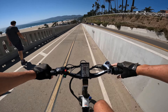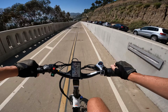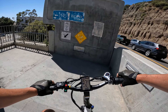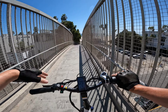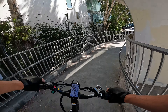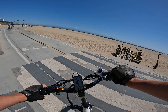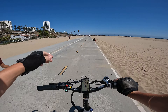Going downhill would be our best chance to see top speed on this bike — you have to let off the throttle and do a little ghost pedaling for the motor to help you. In a headwind the motor is helping us and we hit 27.5 miles per hour. Brakes are really good on this bike — Tektro hydraulic disc brakes and the CST big boat tires at three inches wide. The braking force is ultimately limited by the tire's grip, and these 180 millimeter rotors grab hard. The wide tires stick to the ground to convert that kinetic energy into heat. Official brake test from 20 mph — really good brakes.